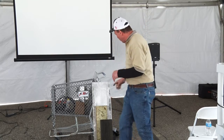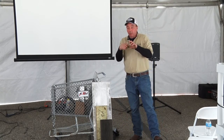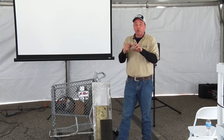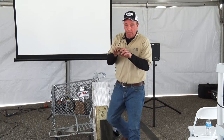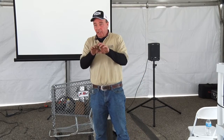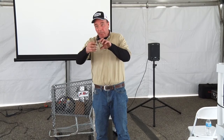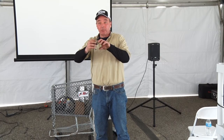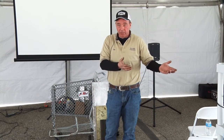What you do is, believe it or not, that grease that I'm talking about, your wheel bearing grease, when you're cruising down the road, it actually turns into an oil, a real thick oil. And when you get to where you're going at home and you're going to park it for the season, you park it, all that oil dripped off the top of the bearings. So the bearing now is exposed. It doesn't have anything protecting it from moisture. Don't unhook.